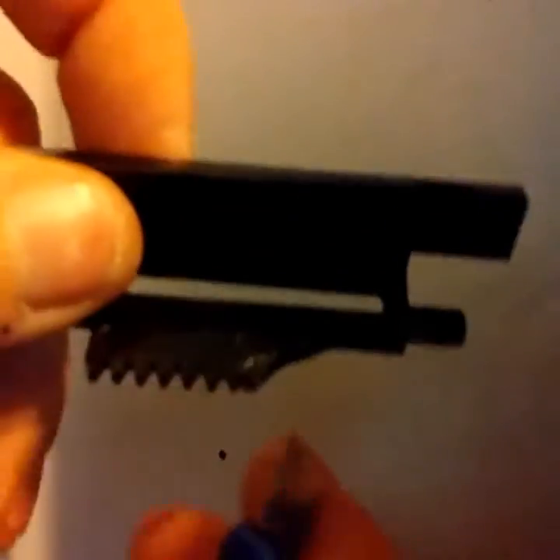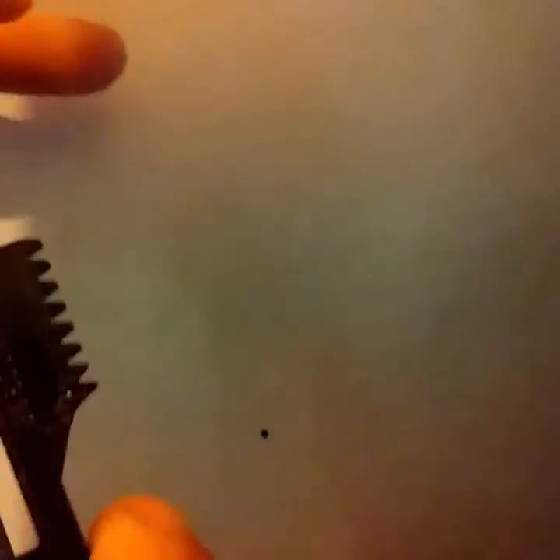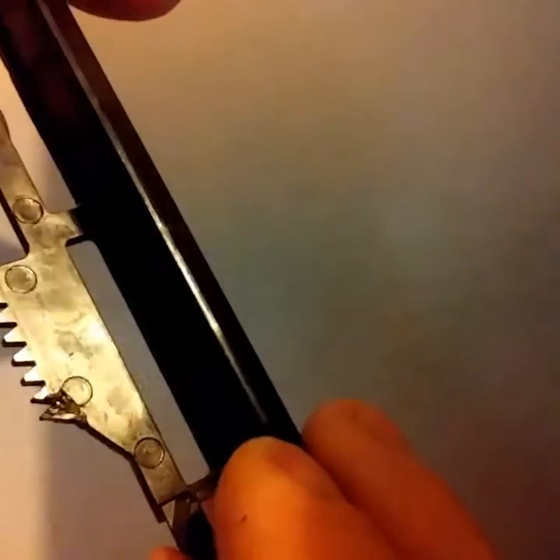Get the shape back into a tooth — just take a razor blade and cut your tooth in. You gotta get it pretty close to what it should have been. Cut the sides down, cut the tooth in. Here's what it looks like when done — you can see the piece I soldered in, I cut down the sides and cut the tooth in afterwards. I probably could have done a better job soldering but it'll do.